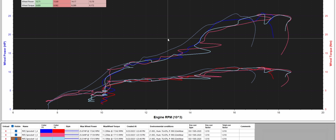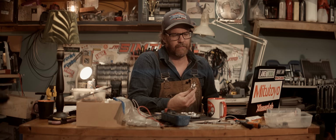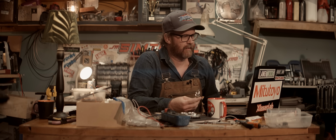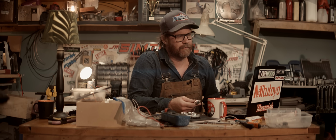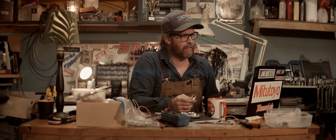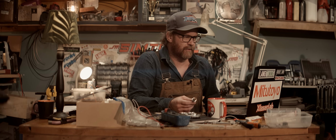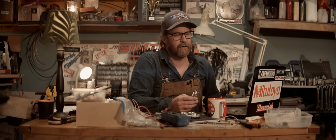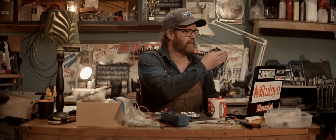So obviously something noise related happened when I closed the gap from 0.7 to 0.3 millimeters now. That hasn't happened before with that kind of gap. But now we're running richer. Now I would think a larger gap would create higher voltage and more interference.